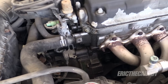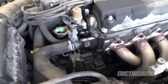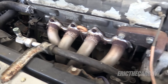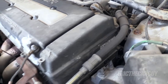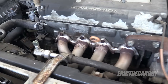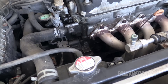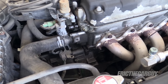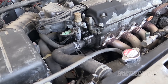Here's my engine the way it is now. Some of you can complain that it's dirty, and it is — it's mostly just dirt with some oil on the outside. If you're washing off oil, I recommend you get some form of degreaser that you can spray on ahead of time. But more than anything else, make sure that the car wash you're doing this at is okay with it, because some of them have special traps for all this junk.